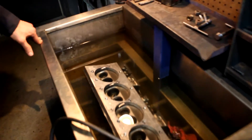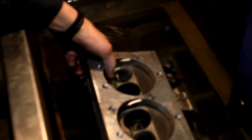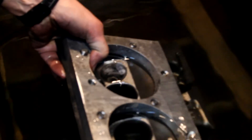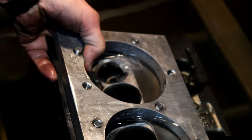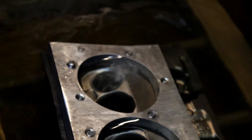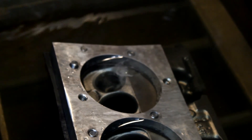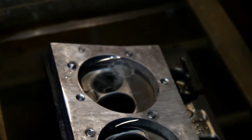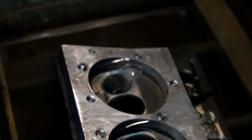The only way you would know if a seat leaks is to test the cylinder head after the seat inserts have been put in. Here's an open chamber head and there's your leak — you'll never catch that by magna-fluxing. That's why we always pressure test cylinder heads before we start on them, and they get pressure tested at least once during the machining process, so that when you get the heads you know you have a good quality piece that will last you for many years.